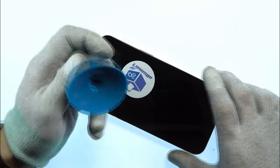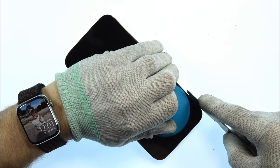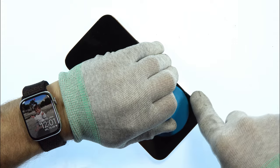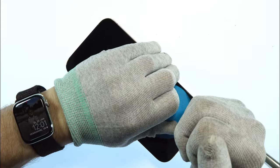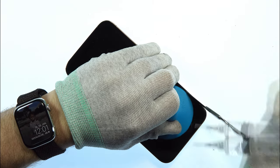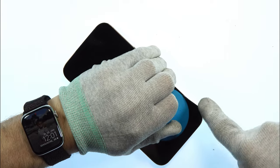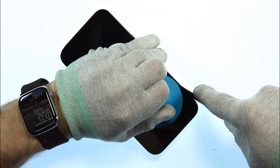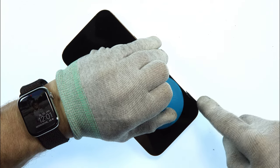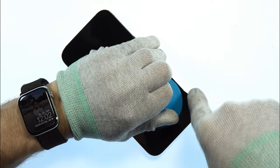To open the device, we now take a suction cup that's also inside of the 13-in-1 set and a scalpel. It's also inside. We place the scalpel on the side of the phone. We press it until we are inside and down to the metal frame. Then we take isopropanol. I'll put a link in the description as well. And now we can gently push up the display so the isopropanol gets between the metal frame and the display so it can loosen the glue.